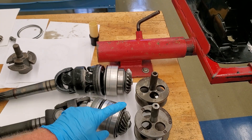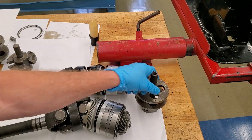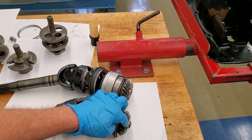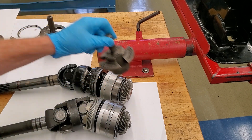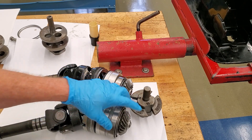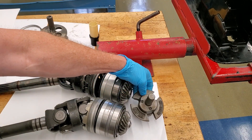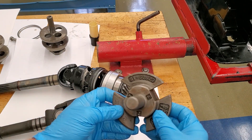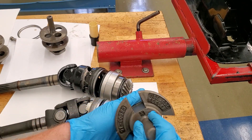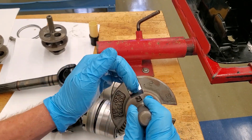Interesting enough, the dimension of this gear uses a separate tool, and even though we have different gear ratios and the gears are very different in size, I use the same tool to measure this gear. The old drive assembly's gear position is measured the same way as the newer drive with the same tool. That tool, part number 91-60523, again has letters X, Y, and Z. You look in the book to figure out your gear ratio off the drive, then put that on to measure the distance to the gear.